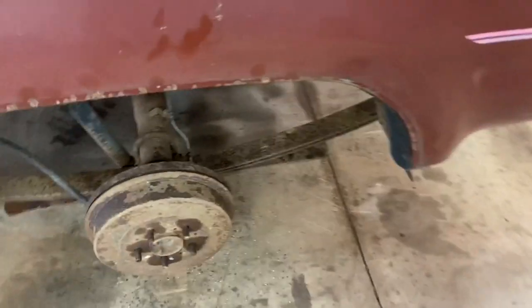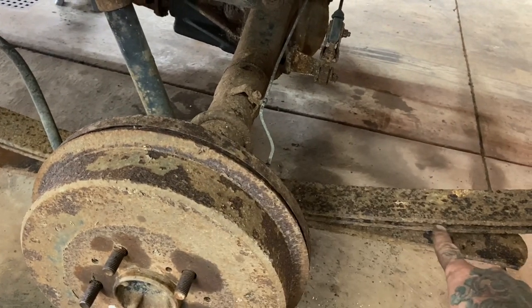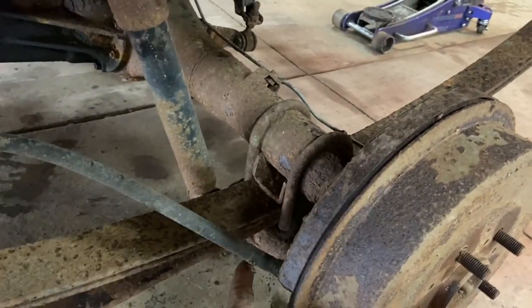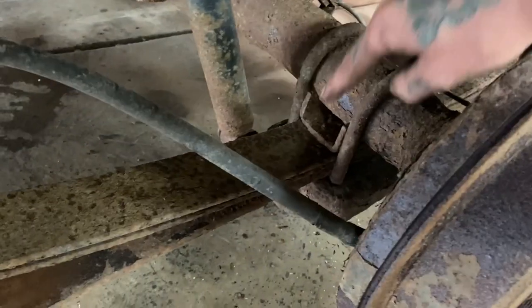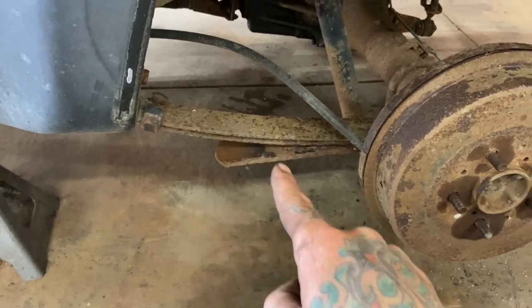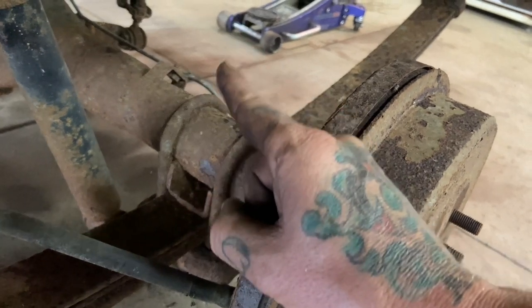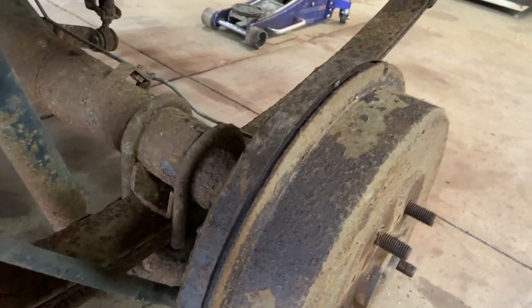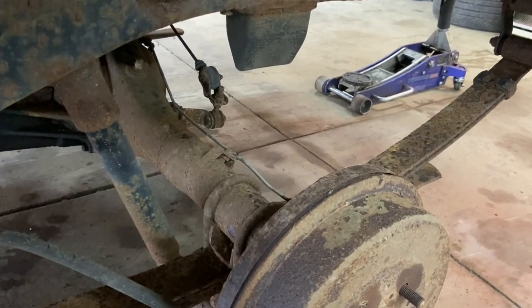The rear is pretty easy, especially since the axle is already over top of the leaf springs on these and on most mini trucks. If not — if the axle was under the spring — you'd have to do a flip kit and move it to the top of the springs. But this one's already done. So pretty much take these U-bolts out. While it's apart, we're going to take the middle leaf spring out of here. That's what the longer U-bolts are for, because we'll have these blocks. All it does is push the axle up higher on top of the leaf, which lowers the vehicle. I've got 3-inch blocks, I'm going to take a leaf out, and hopefully I can get about 5 inches of drop out of it.